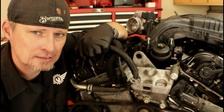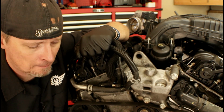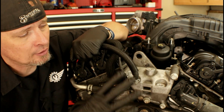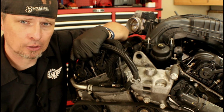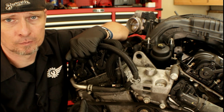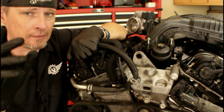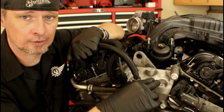So we've talked about all the positives and all the benefits that we're gaining by making the swap. But there is one downside to this that I can come up with. Now, me and you know that you made this swap, right? We know that you need a 2014 oil filter from this point forward, even though this may be a 2011 vehicle. The problem that comes up is if you or somebody else takes your vehicle in to be serviced. Now the mechanic, he or she, they don't know that you made the swap. They only know that the year of the vehicle is 2011. I showed you that you cannot really install the wrong oil filter into that cap and reinstall it. But if there's a will and there's a way, there's chances that somebody's going to break something trying to. Because that's all they know is what filter the vehicle needs. They don't know you made a change.